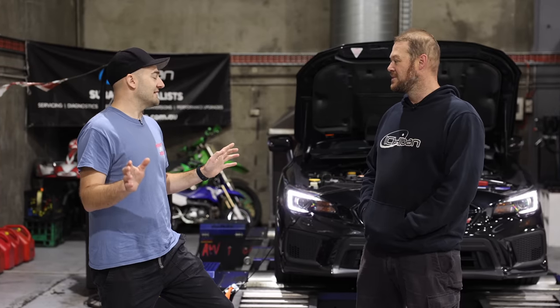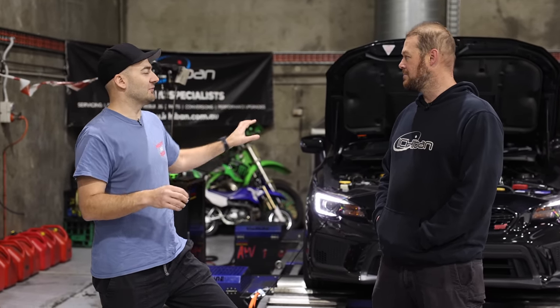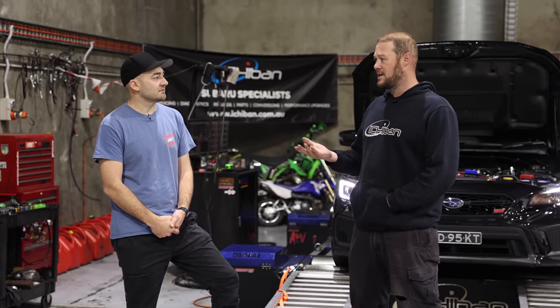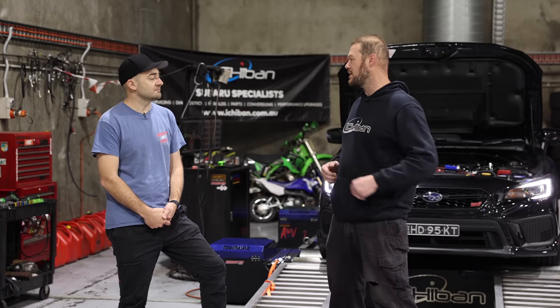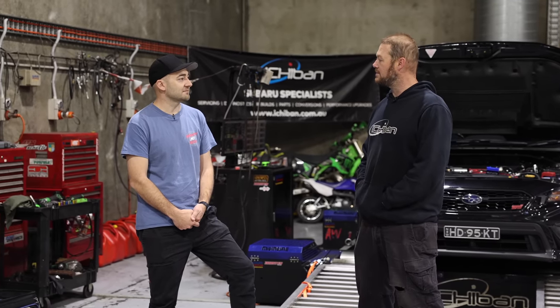So obviously you don't drive it like crazy, but what changes happen from that stage where you're roughing it out to now? What are you refining? Basically, it's fueling, as I said, so we will trim that up. At the moment, it's probably 85% there. So we'll do the fueling, and then we start to put the timing and boost into it. We're looking for detonation. That's the biggest killer of them. So it's a fine line. We want it to be able to survive on the track, but we want to get the most out of it. Then we'll start to play with throttle tables and stuff like that as well, so make it nice to drive.